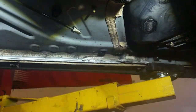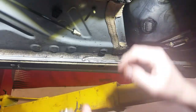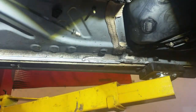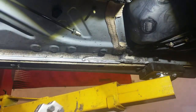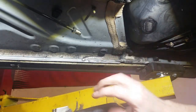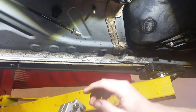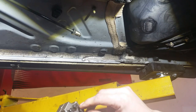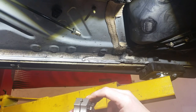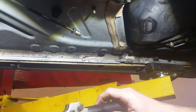So the other type of flare, your American or classic car SAE flare, that's an angle here, it's not 90 degrees. So this wee tool here, I bought it from Laser. You can get other wee handheld tools, and they'll either do DIN or SAE, one or the other. The handle wouldn't be as thick and not as much to hold on to, and there'd only be 2 clamping bolts, whereas this one has 3. So it is a wee bit bigger, and it'll maybe take up a wee bit more room on you.